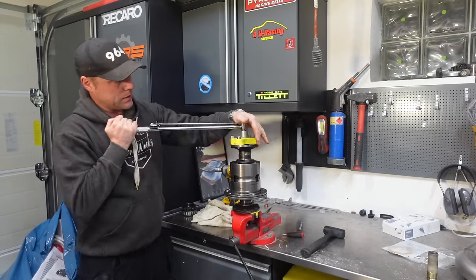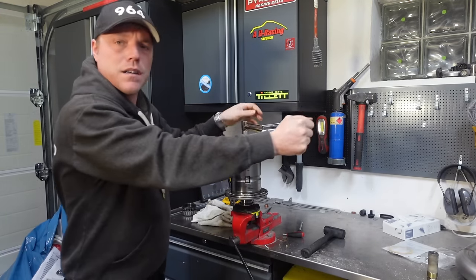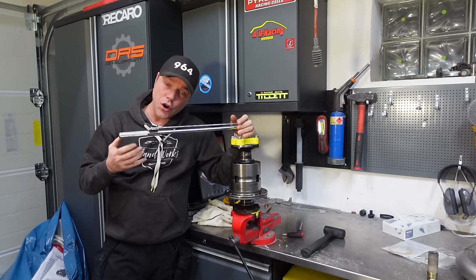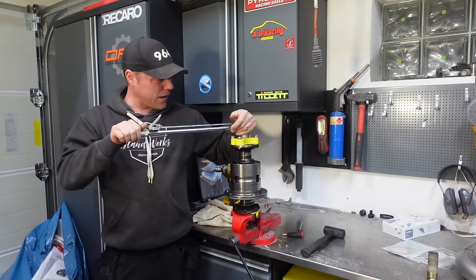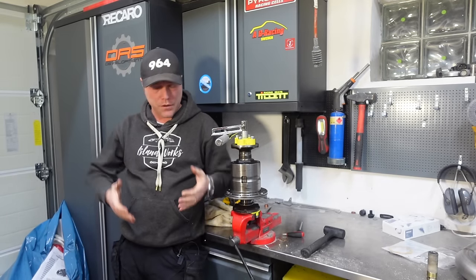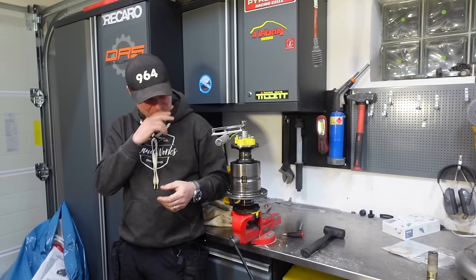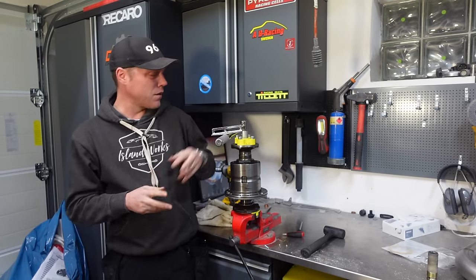This diff is right now at about 100 newton meters, which is a lot more than what I've heard it should be, and I'm a little worried. If the diff is too hard, the car will severely understeer — coming into a corner the wheels don't want to release from each other, making it very difficult to steer. You'd have to drive very aggressively, which maybe isn't what I want on the first lap.